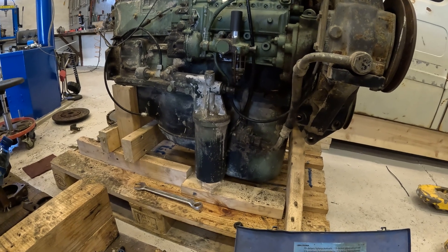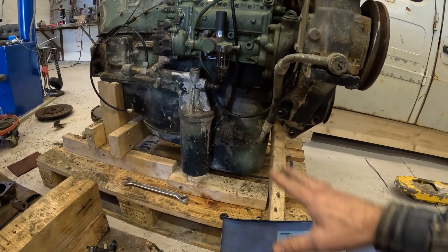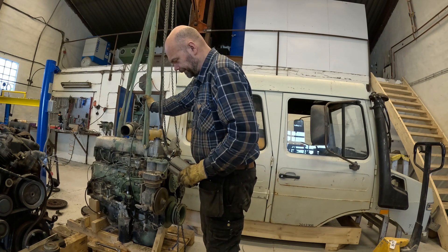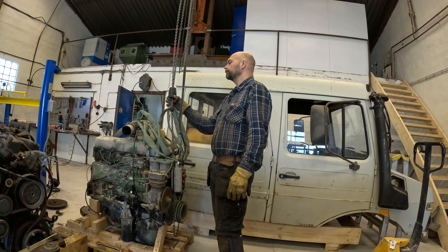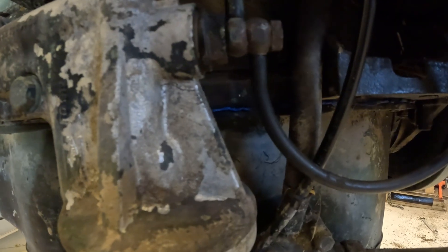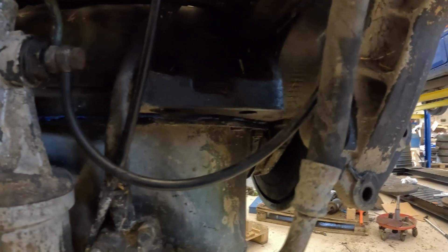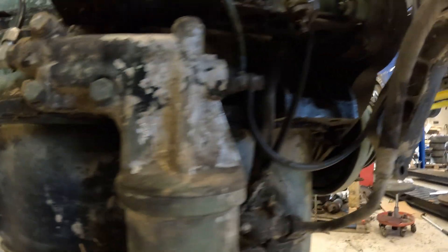I believe that I have to get that oil pan onto that engine - that one is full of oil. I'm actually a little bit curious because I believe it's the rod bearings that are shot, at least one. So let's get this one elevated and get the oil pan off. Oh, you can see the blue silicone - we need a new gasket also. The list keeps growing - order this, order that, order more.